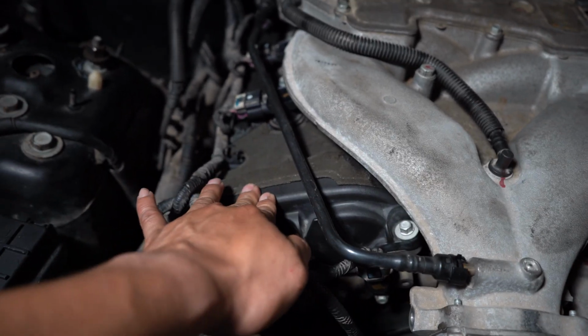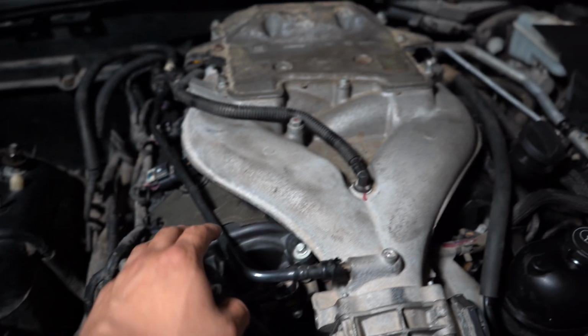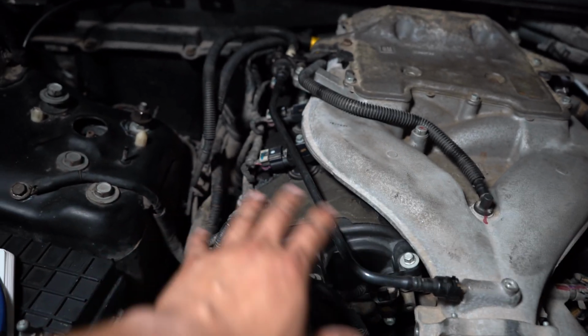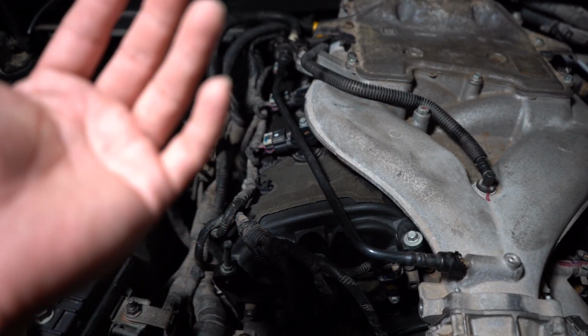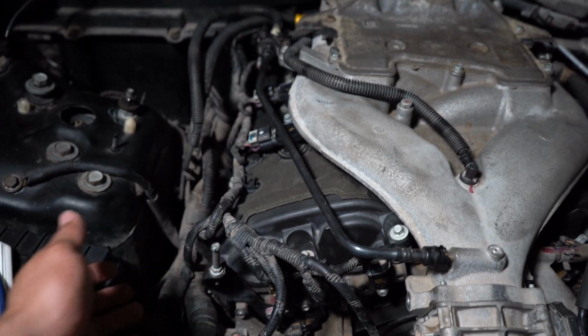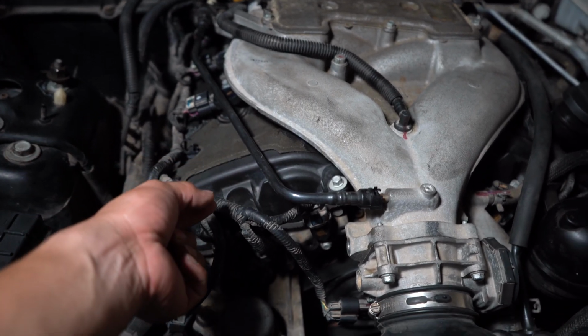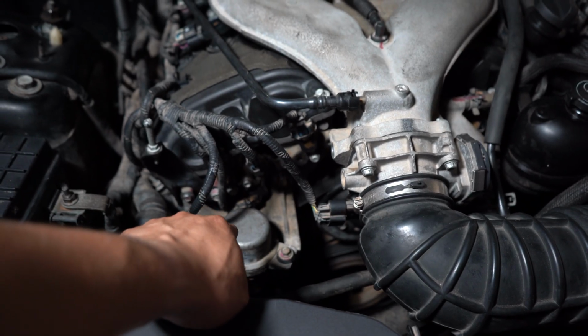Once I took off the valve covers on both sides and put them to the side, I examined the camshaft lobe and everything, to see if everything was in place, and if any lifters or rocker arms were disabled or anything like that. Everything seemed really good. Further upon inspection, the chain was really loose. Valve cover off, this chain is really loose. Indicator, you have a bad tensioner.